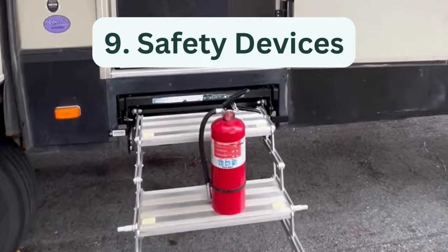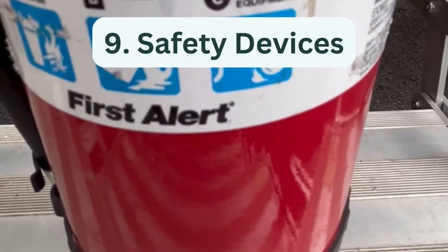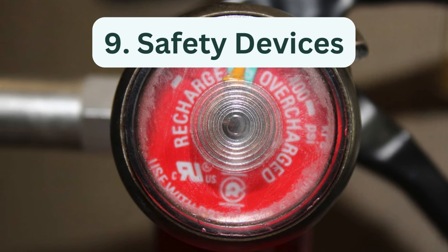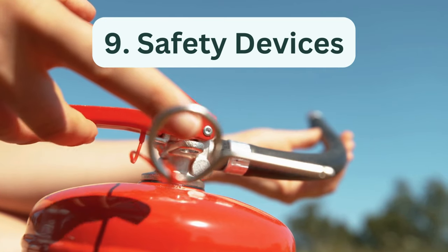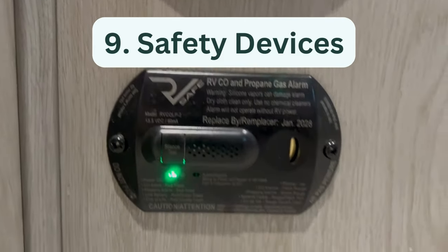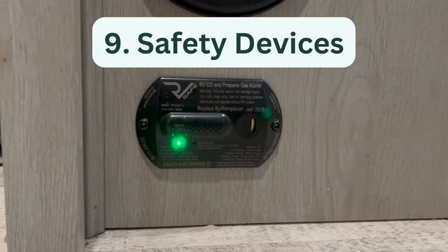Nine, inspect safety equipment. All RVs should have both a fire extinguisher and a gas detector. RVs come with one of two types of fire extinguishers: rechargeable and disposable. If your fire extinguisher has a dial with a recharge and overcharge section, it's rechargeable. Rechargeable extinguishers should be serviced every six years — check with the local fire department to see if they offer this service. Disposable fire extinguishers have a dial that reads either full or empty; the extinguisher needs to be replaced if the dial points to empty. RV gas detectors also need to be replaced regularly — these detectors typically have a lifespan of about five years. If you have a used RV and don't know when the detector was installed, the production date is printed on the back. It's best to always have a replacement detector on hand so a new one can be installed as soon as the old one malfunctions.